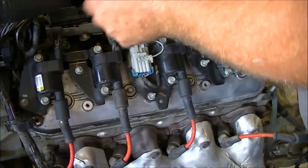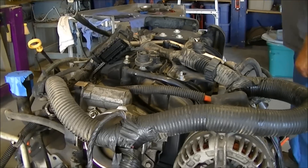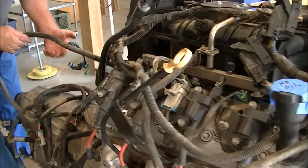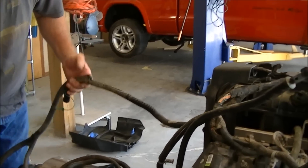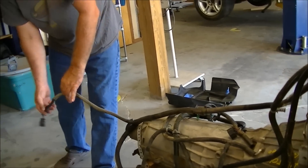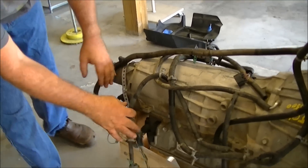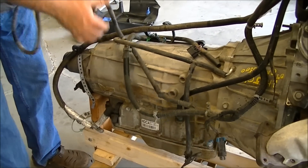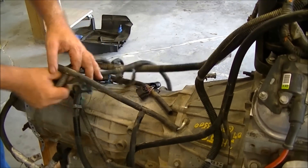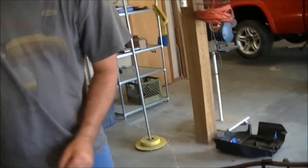As we look around the motor, all I'm looking for is anything that's broken, more than anything. The next thing I'm going to do is start taking the wiring harness off. The wiring harness extends all the way back to the transmission, and it also has the rear O2 sensor connector that comes all the way to the back. I'm just going to work in order all the way from back to front. If I wasn't videotaping this, I would be writing down and numbering all these connectors, but since we'll have a videotape record of this, I'm not going to.